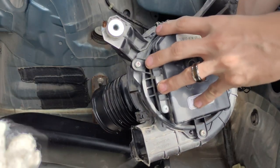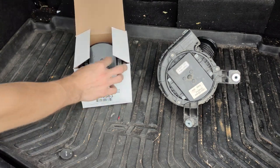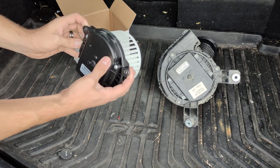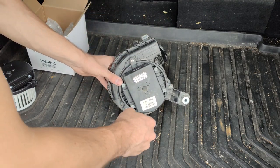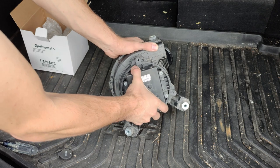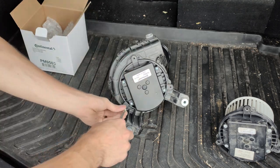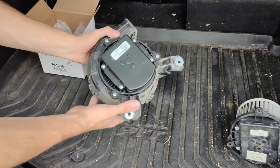This is the fan motor we're going to be replacing. Here's our factory fan assembly — this motor is what we're going to pull out and replace. Our new unit is made by Continental. We ordered it through Rock Auto because it was a great price and more importantly in stock, and it should be similar quality to OEM — this isn't an endorsement of the brand, just what we're using today. Removing this blower motor from the housing is super easy — it's just three Phillips head screws. Pull the assembly backward out of the housing and take note of which tab has the alignment peg hole in it. Our replacement will fit in exactly the same way.